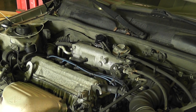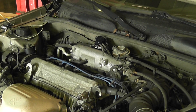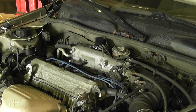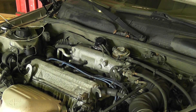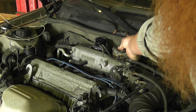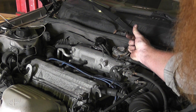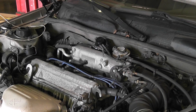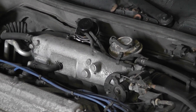The first thing I did, honestly, was just — with the car running and warmed up — I reached my finger up in there to make sure the EGR port is not plugged. It stalled the car, so I know the EGR port is not plugged.